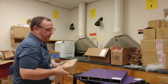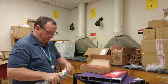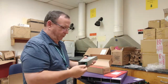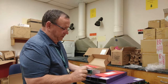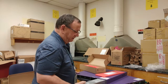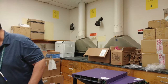I have elected to use two power supplies. I plug one into a UPS and the other one into just regular wall power, and our wall power is actually protected by a generator, so I've always got protected power. It's nice to have so you can walk the switches around power-wise and not have to interrupt service at all. This is the power supply — it comes with a little strain relief for the power cable to keep somebody from accidentally pulling it out. Just slide it in with the green tab facing that way and it locks into place. These are hot-swappable, which is really nice.